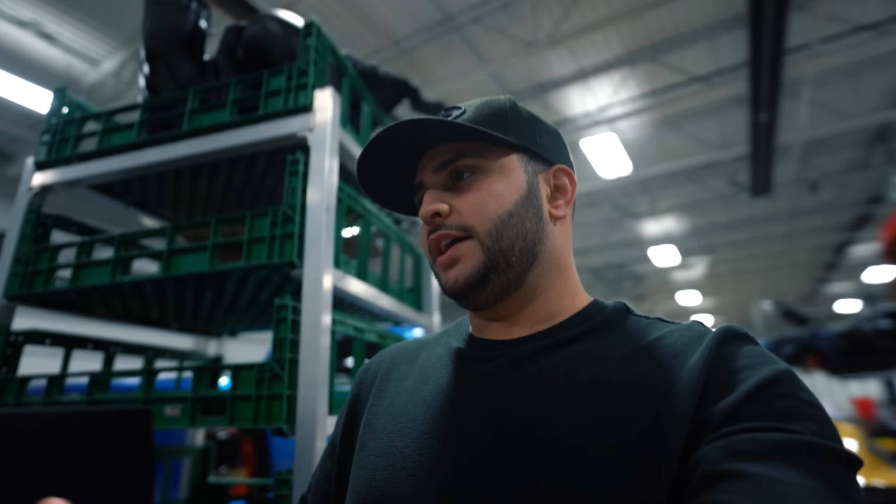I would much rather not get these wheels, but it's just so hard to find wheels that will fit around my brakes. I have these carbon ceramic brakes, and it just makes life really hard because they're huge, and there's not many wheels out there that are 18s that would fit on the car. And the reason I need to get 18s is so we could get bigger tires, and that will pretty much help us get traction, because these tires might not work. They look good. It would probably work if the car was stock, and well, this car is far from stock.